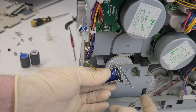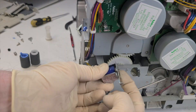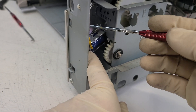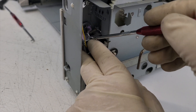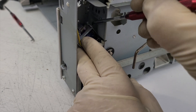Make sure to test the solenoid again before securing it back in the printer. Gently insert the solenoid into its original position, ensuring it fits precisely into the slot. Put the solenoid back in. The lower solenoid is responsible for printing from tray number two.